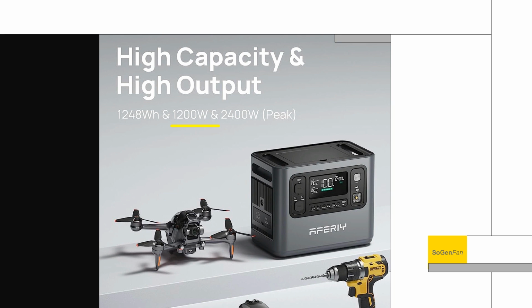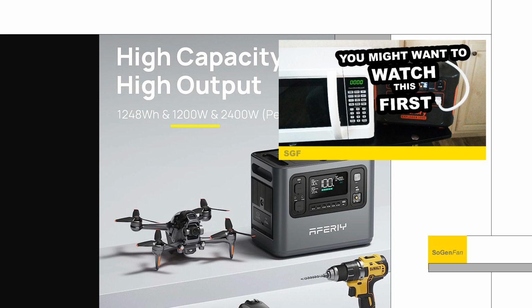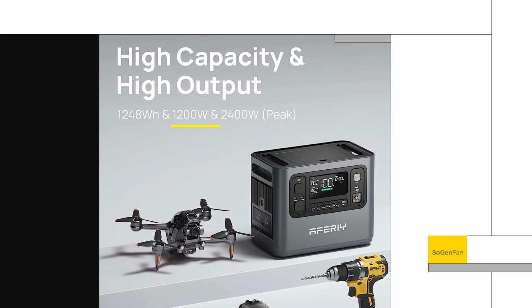But as I've talked about in some of my videos, you can do a lot. You can basically do everything you're going to need to do with 1,200 watts. You just got to get the appropriate sized appliance, right? If you want to do cooking, get a 1,000-watt hot plate. If you really want to microwave something, get a 700-watt microwave. Again, I've talked about this: the output wattage of a microwave is different from the actual amount of power it draws from the wall. So a 700-watt microwave will actually draw around 1,000 watts. But still, you could get a little 700-watt microwave, and everything else you should be able to run with this unit. And I do like to see that they're giving you a true double of the surge, right? We get double, 2,400 watts.